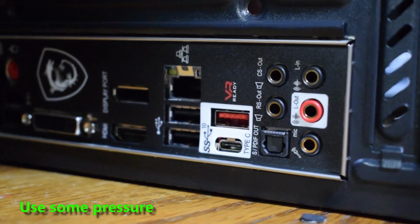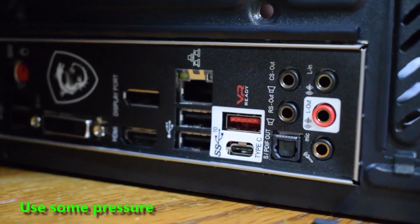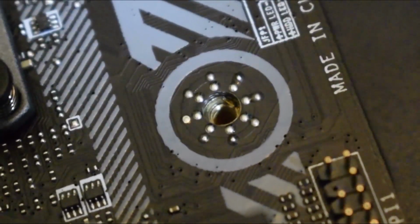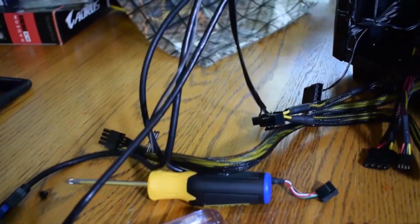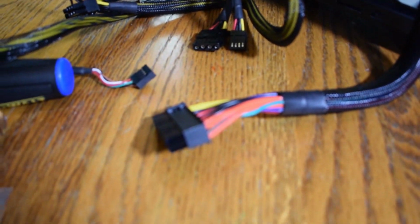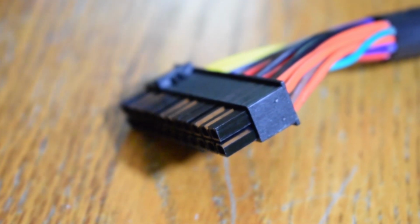Push it around ever so slightly to fit into the porthole tray that came with it. Get the screws and screw in the motherboard. You will see all the holes in the motherboard on where to screw. Before I put in the GPU, I will do the wiring. It's generally easier to wire without the GPU in the way.